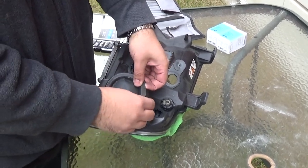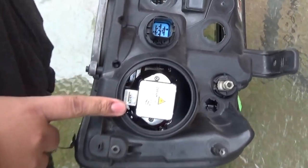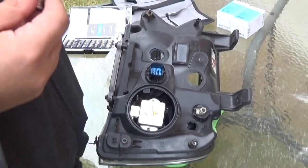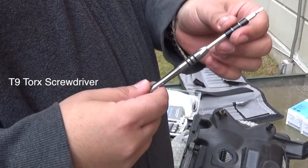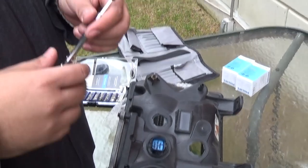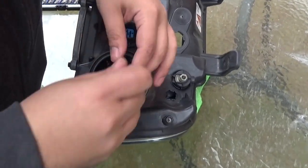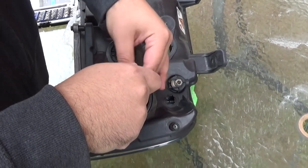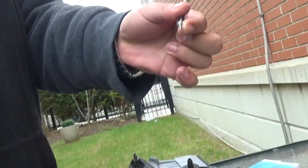What you're going to do is remove this rubber piece right here — just pull back on it. And this is what the bulb is; this is the original bulb, it's an Osram bulb. You're going to need a tool like this — this is a Torx T9. You need something slim because it needs to fit in here to remove the screws. You might want to go with something magnetized so it can hold the screw, since it's so tight in there. There is a screw over here.